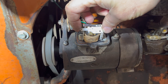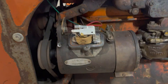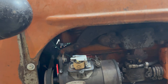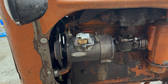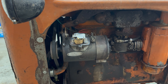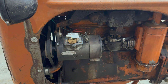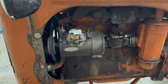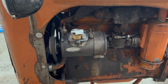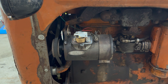I can pull it open — you saw it open back up. The purpose for that is that if that switch stays closed, the battery then feeds the generator instead of the other way around. And if the belt weren't here, the generator becomes an electric motor. There's not much power going the other way, so it'll just cook the wires, drain the battery, or start to heat up and wreck the wires in the generator itself.